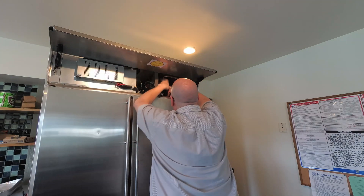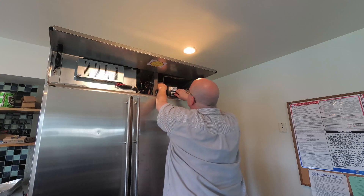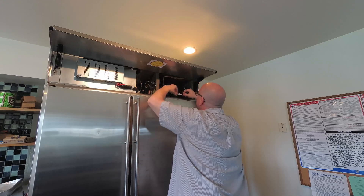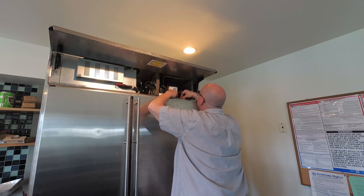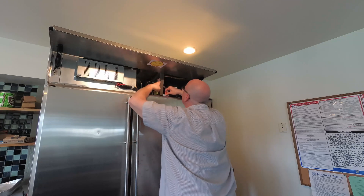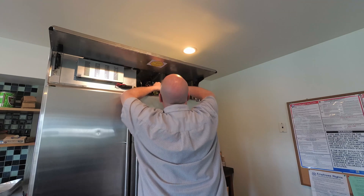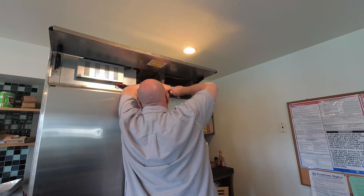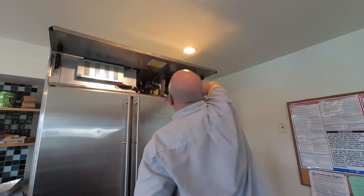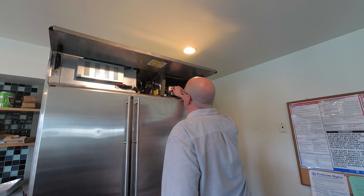I finished putting the last few panels back on and tucking the wires. It took almost a day before everything was fully working — I plugged it in, checked the compressor was running, unplugged it, hooked up some wires, plugged it back in. It didn't start immediately, so I unplugged it for about five minutes and plugged it back in. At this point it's been a week or two and it's holding cool — easy replacement, I was surprised.